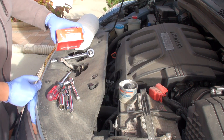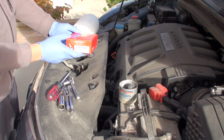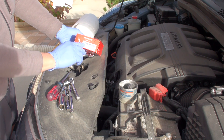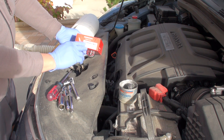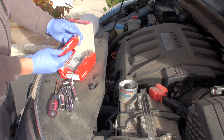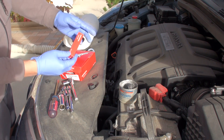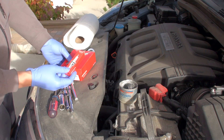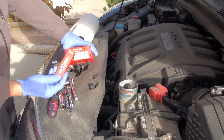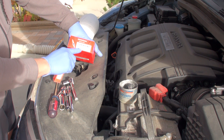Because this van is a 2008 Honda Odyssey, it uses a slightly different VCM engine than the 2005 through 2007 models. It uses a longer spark plug, and the part number for 2008 through 2010 is 12290-R70-A01. I'm using the Honda-branded plugs which are actually supplied by NGK, so you can buy the NGK equivalent — part number ILZKR7B11. The price from the local Honda dealer versus an aftermarket parts store like O'Reilly's is exactly the same, so why not get them from the dealership where you know they're right.